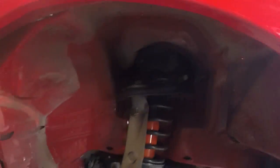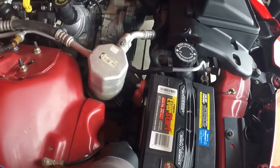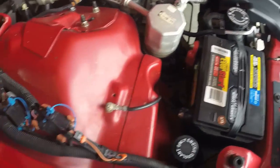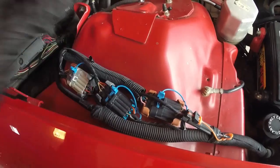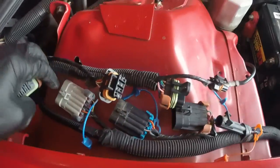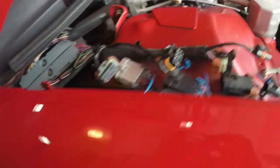Once the liner's out — you can see it's pretty dirty in there — we're gonna unhook the battery. Grab an eight millimeter wrench, take the battery loose. I'm just gonna take the negative cable off, and then we're gonna unplug all of these plugs on the top side. Once we get these unplugged, you'll notice they're stuck inside the inner fender. On the bottom side there are three pieces — you can just push those and you'll be able to pull the rest of the plug loose.